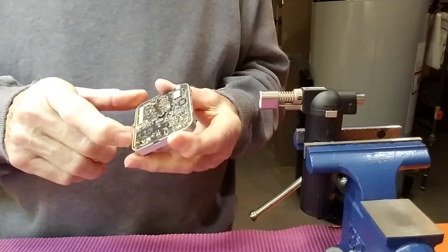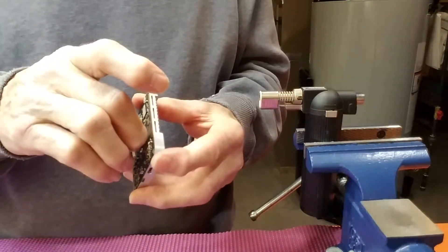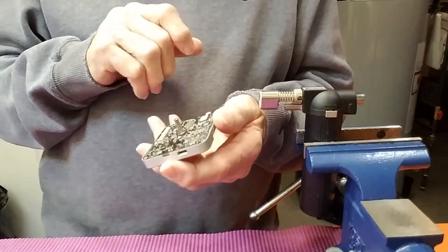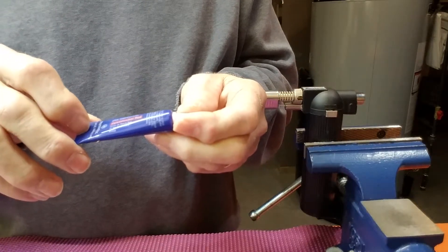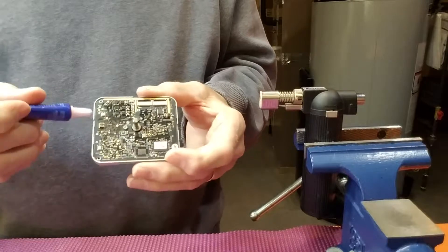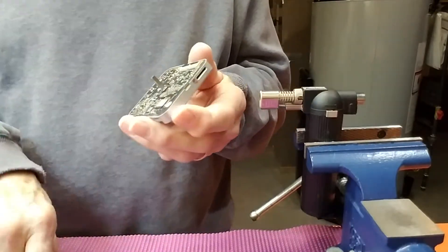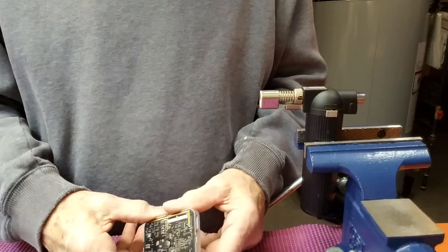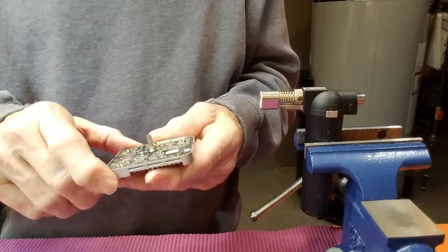You may have to take it apart four or five times, pulling this back off and putting it back on. But you can lift the magnet with your fingernails, turn it a little bit, push it back down, and go a little bit at a time. When you get it to the spot where it centers perfectly, then I use red Loctite — high temperature red Loctite. You can't use the blue. Put the red Loctite around the magnet, usually on both sides, and let it sit for about an hour till it sets. Reassemble everything and you should be done. As long as you didn't move the magnet when you were putting the red Loctite on, the camera should center and you'll be good.